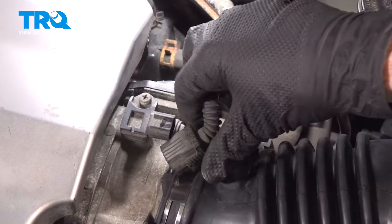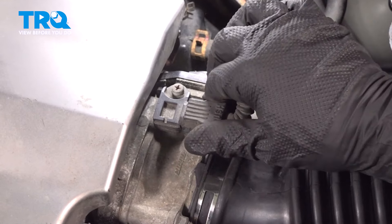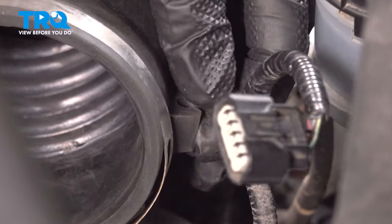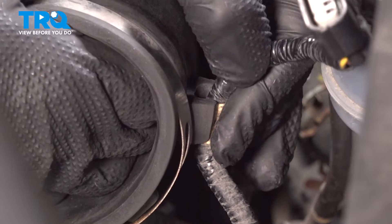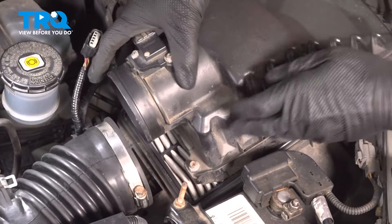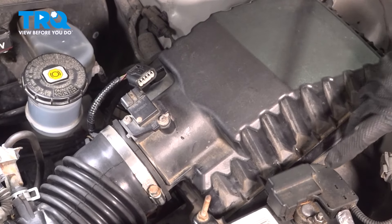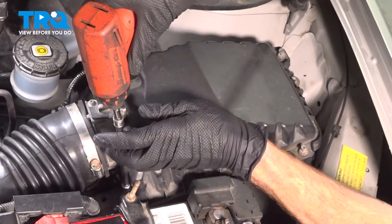It's time for the electrical connector. With the locking tab facing straight up, press it in, listen for a click, and give it a tug to make sure it's secured. We'll make our way from there to re-secure our wiring harness along the back side of the inlet tube — there's a small mounting area where the wiring harness fits right in between those two ears. Let's move along to our upper air filter housing. We're going to slide this onto the air inlet tube and press it on as far as possible.